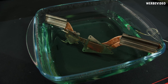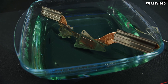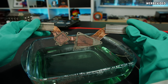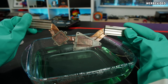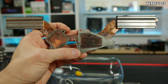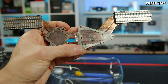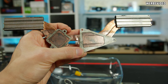After four hours in the bath, the result doesn't look too promising. Outside the solution, it still looks like copper — even dirty copper — not like nickel at all. After cleaning and drying it, there's a slight silverish tint, but you can still clearly see the copper color through it. I'm not happy with this result.